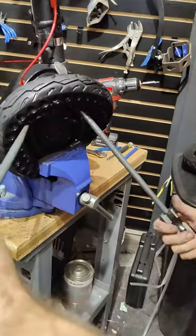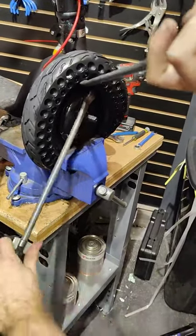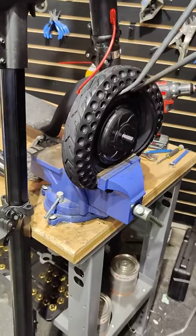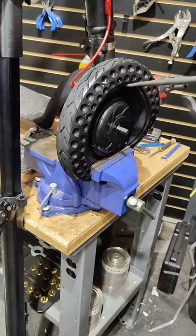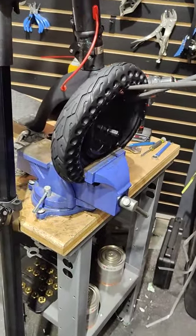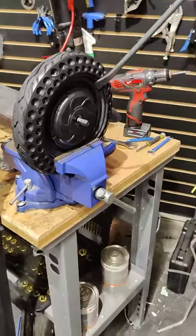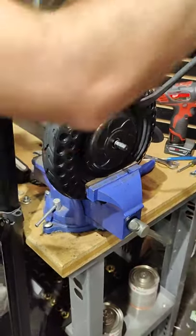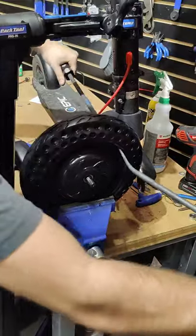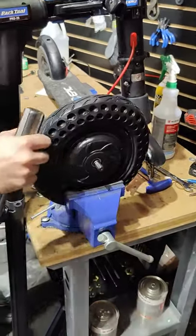Some water makes it slippery — this is looking good. Once you're at this part, you'll have to go to the other side of the tire. Use this side to lift it up just a touch, go into the tire, pull this side out, and just pull it back so it kind of falls into place. You'll have to do this a few times.